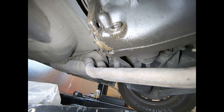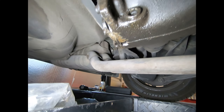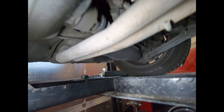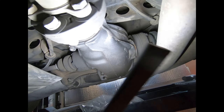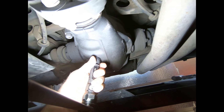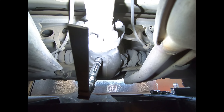Looks like he's given that a bit of a belt. Oh geez, that's the whole rear suspension — I'm not taking all that off. I wonder why that's leaking there. Anyway, as I mentioned, this gentleman likes to do preventative maintenance, which is good. He said he wanted to replace the flex joints. I said, 'Have you checked them to see if they're okay?' He said no, but age, blah blah blah. And you can see they're cracked — so this is good preventative maintenance when you consider the torque this engine produces. Oh dear, I've just spotted something else — that boot is split. Damn it, that's going to be a lot of work.